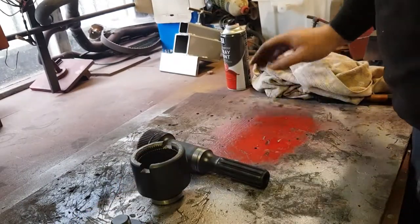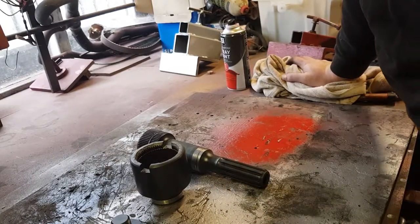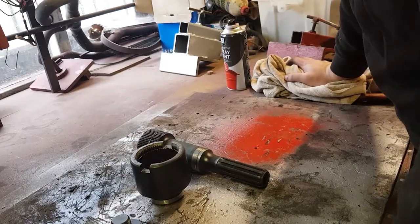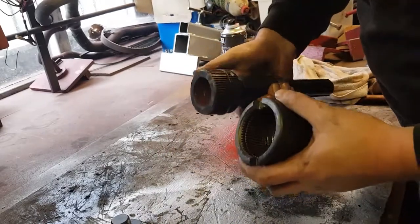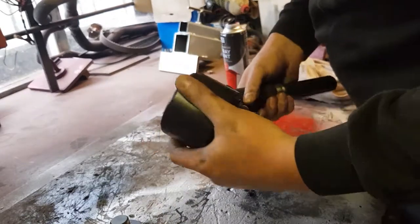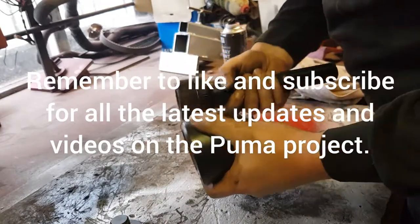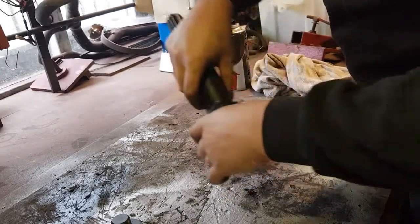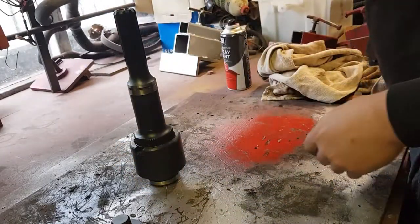That's the main problem — there's a new one coming. I've ordered the oil seal for the gearbox and for the transfer box, because there's a lot of crap that gets stuck in places, so while it's out, they're getting done too. I do believe the main problem from the factory is this bit where it actually connects together was fitted dry. Mine's done 76,000 miles and I've heard of them going from 30,000 miles onwards. Whoever's replaced it hasn't cured the problem because they've fitted it dry. When the new one arrives, I shall update you and we will go from there.